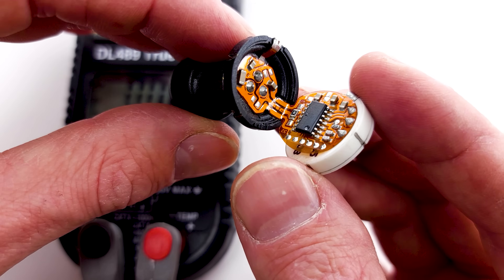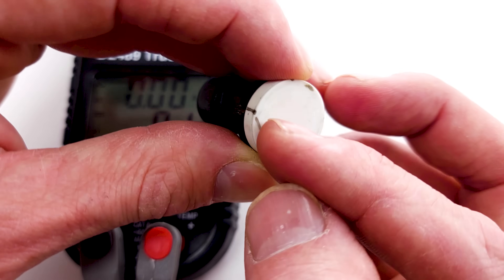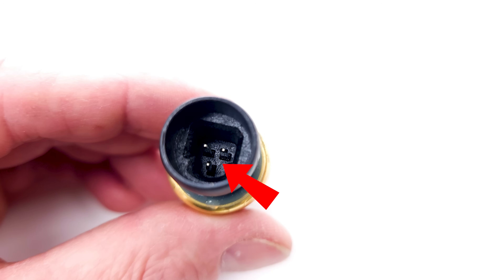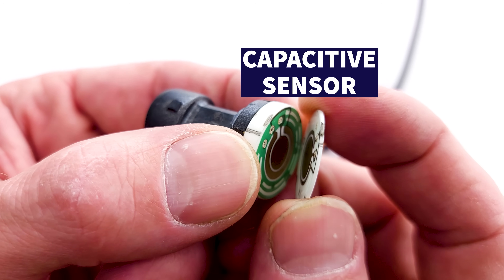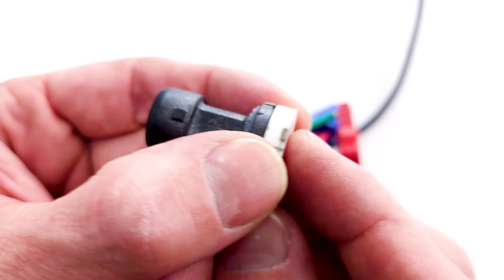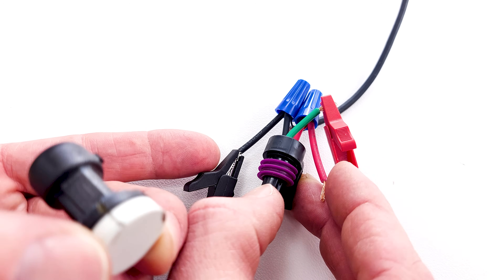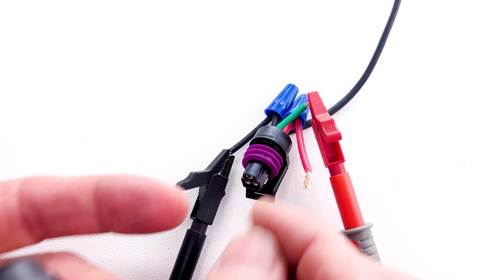Here you can see your flexible circuitry, and the ceramic section right here. There's a front piece we're going to cut off so you can see inside. Those three terminals extend to the three terminals that connect to your wiring harness. Cracking this plate off, we have a capacitive sensor with two opposing plates. You could also have a piezo-resistive type pressure transducer — there are a couple of ways to make a pressure transducer.